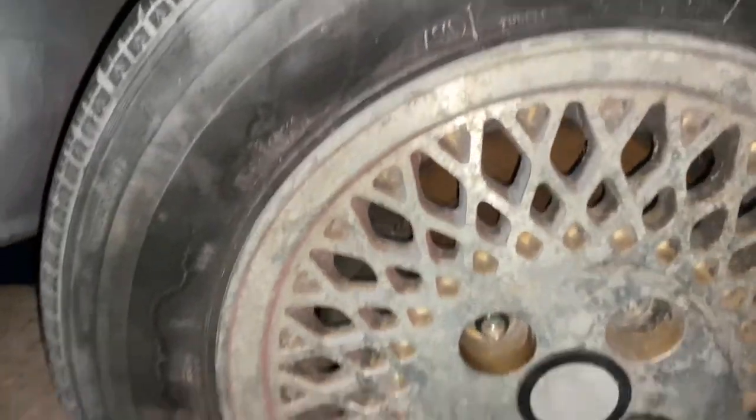All right, you guys. CRX has been converted to rear discs. Now I just need to install my brake booster and my master cylinder. Then I could bleed the brakes, but I'm not gonna do that until I have the EX spindles on there. That's gonna be another video because we still need to get tires fitted onto wheels that will fit over these brake rotors.